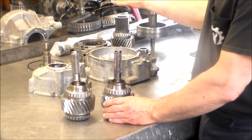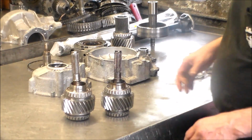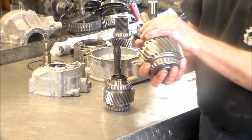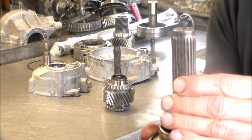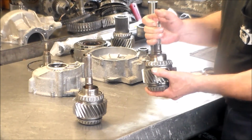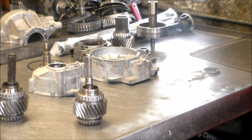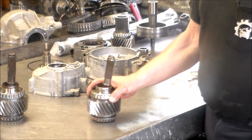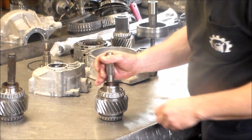But you can see this is flopping all around. All right, it was on the drive shaft. The splines, I don't really care too much for the splines. There's also master splines on this. So when we put this back together, there is a master spline. There's one on that side. There's also one on this side. So we just line those up. Okay. So again, this is the bad one. This thing is shot, and I guess this let go the last 5 miles of his trip on his way to me. And again, he didn't think he was going to make it when I drove the car down the block. Wow, it was bad. Even driving it around the backyard to bring it into the front yard, it was bad.